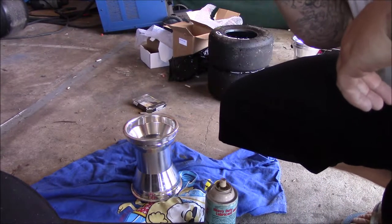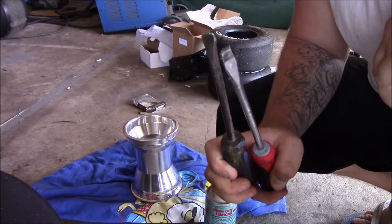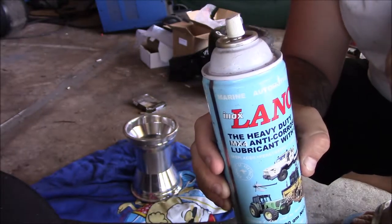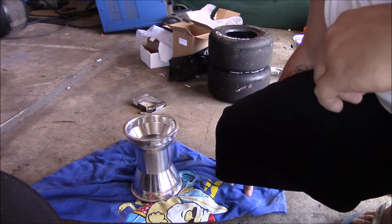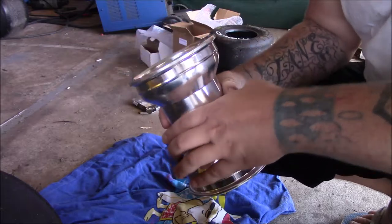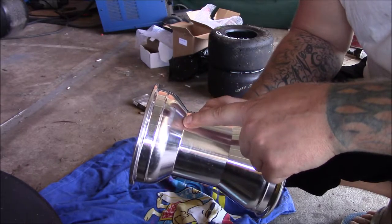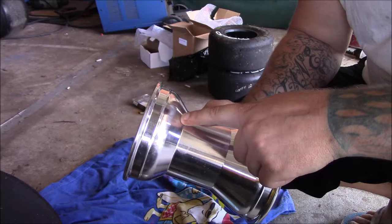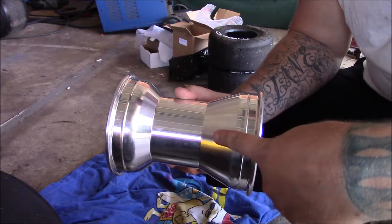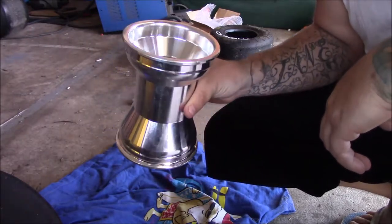Alright, now we're going to try and fit the tyre. A couple of things I use: two flat heads — it's going to help with pulling the beads on — and a little bit of slippery stuff. Doesn't really matter what you use; you don't want to use a great deal of it though, just enough to help the dry tyre go over the bead of the rim. So what I do is I start with the back side of the rim — I always put the tyre on from the back side. This is because there's a less gradual curve there for the bead of the tyre on the rim, whereas on the front the slope is a lot longer and it usually takes more effort. So I start with the front side face-down.